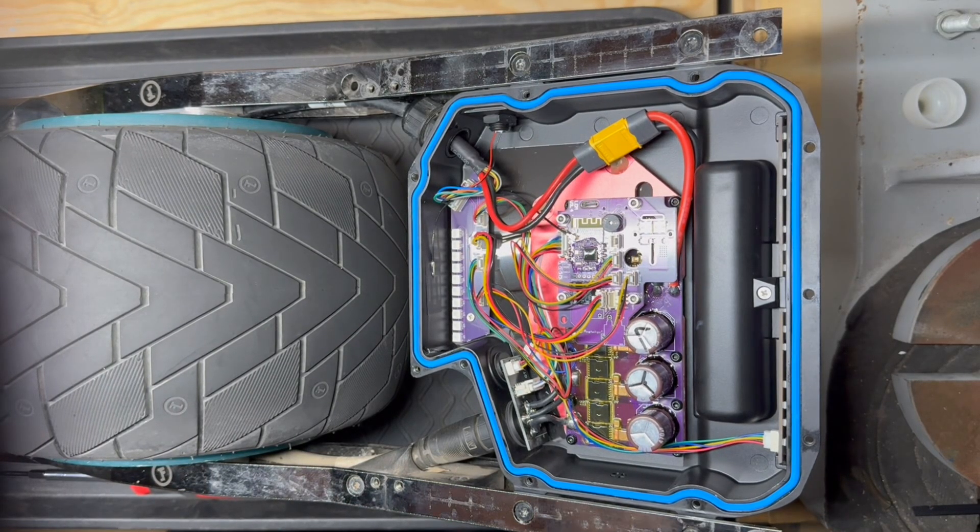I put in a couple of GTV power kits and found out that one of the boards had a headlight and taillight that did not work. I ended up swapping the LCMs and found out the LCM was the issue. I didn't jump straight to that — I took out my multimeter and poked around a lot but wasn't able to find anything too crazy different between the working and non-working board. So I went to more extreme measures and swapped the LCM. I'm going to show you what I did to remove the LCM from the GTV power kit, going through best practices fairly quickly.